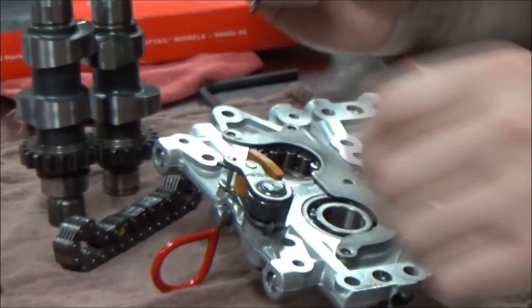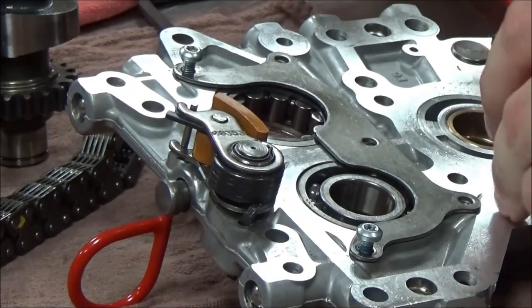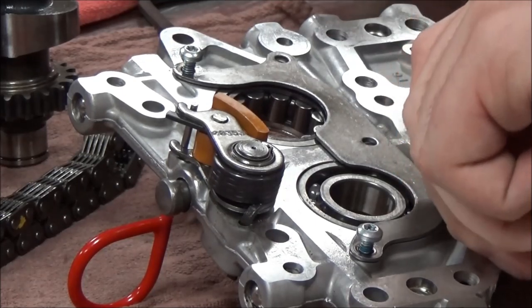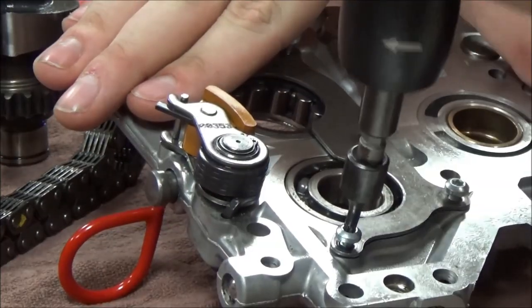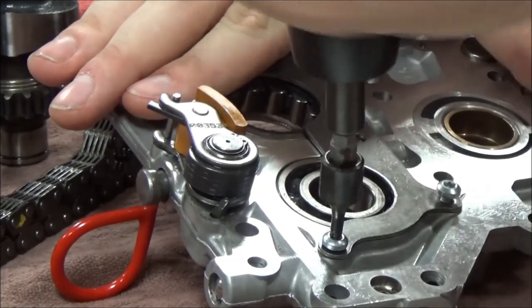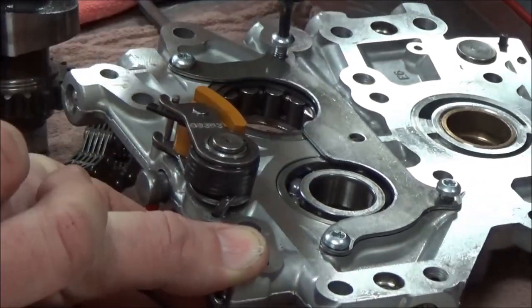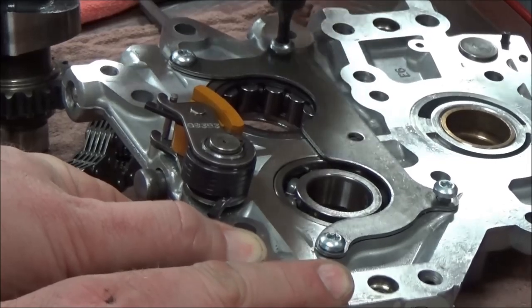You're going to see here we've got a different tool. We're going to go ahead and install these. Just for review, that plate has been thoroughly cleaned and dried before even considering attempting to install this. Just get them where you're going to get them kissed, and then when he gets down, the service manual calls to install them in a clockwise pattern. It's still loose — it's not all the way on. He's going to get really nice and close, and then the next time around he'll do the final torque.